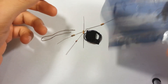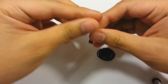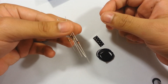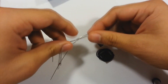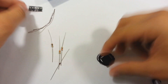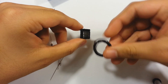So let's get to what's inside this bag — it's going to be an anti-static bag. There are a couple of components here: a couple of resistors and diodes. There's going to be two 330-ohm resistors, 100-ohm resistors, and one diode. There's going to be some solder included, some LEDs, the mod chip itself, and some 30-gauge copper wire.